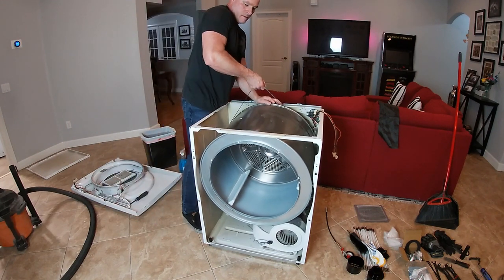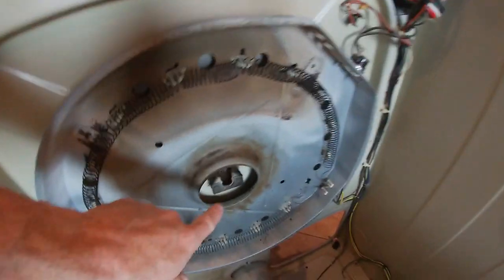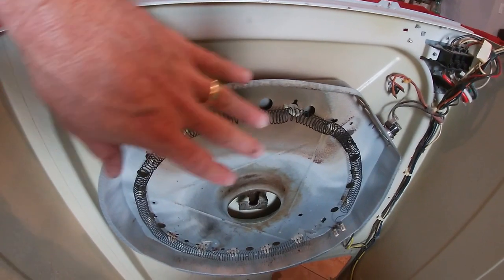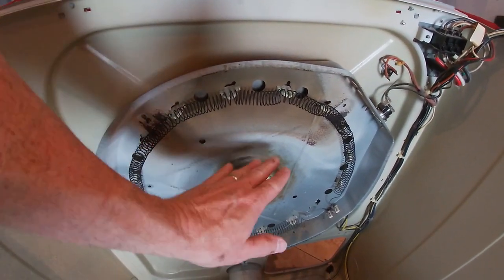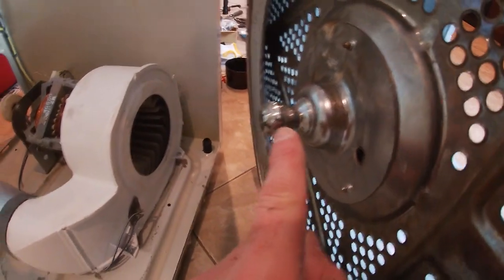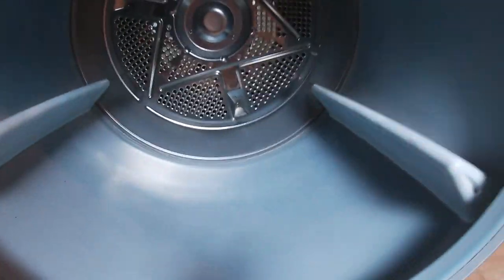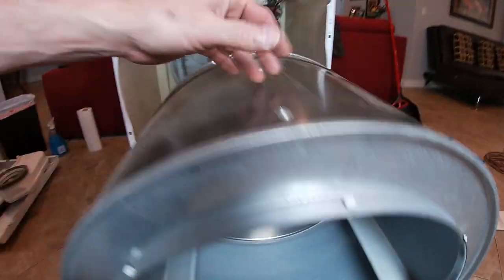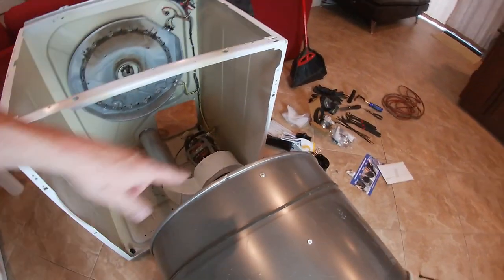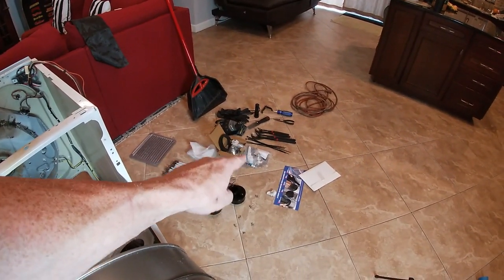Now we can lift this up and out. Let's bring you guys in for a closer look. This right here has been eaten away and that is why the drum is wobbling. As you can see by all the heat marks on here, this thing is getting way too hot. Part of that is because of the buildup of the lint, and the other part is the wobbling - this is creating friction which creates heat. We're actually going to take this off and replace it with a new one because it has indents in it. As for the drum, the drum is fine - no damage or things that need to be replaced. The belt actually had good tension. I'm probably just going to reuse the exact same belt - I've got a spare in case I ever need one. So let's take this little cup out, the damaged piece, so we can compare it to the OEM or the knockoff.